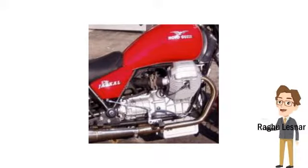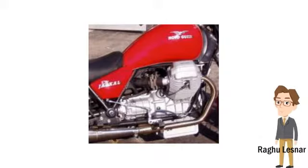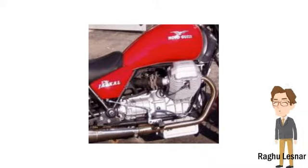The longitudinal crankshaft two-cylinder V, as seen on Moto Guzzis and some Hondas, is less common. This orientation is suited to shaft drive, eliminating the need for a 90-degree bevel gear at the transmission end of the shaft. A longitudinal crankshaft engine fits neatly into a typical motorcycle frame, leaving ample room for the transmission, and cooling is facilitated by cylinder heads and exhausts protruding into the airstream. However, longitudinal crankshaft mounting is associated with a torque reaction that tends to twist the motorcycle to one side on sharp acceleration and in the opposite direction on deceleration. Many modern manufacturers correct for this by rotating flywheels or alternators in the opposite direction to the crankshaft.